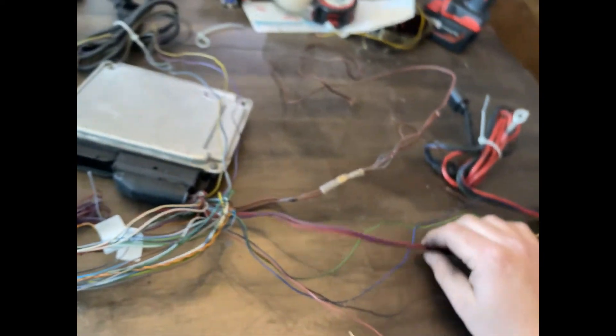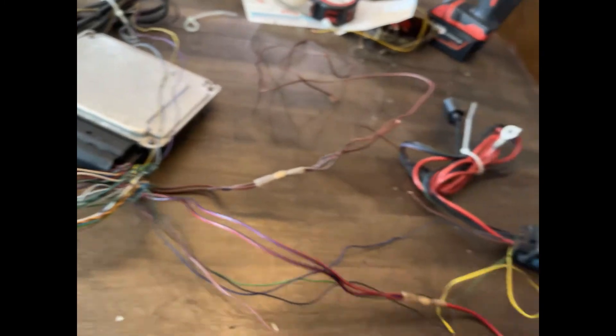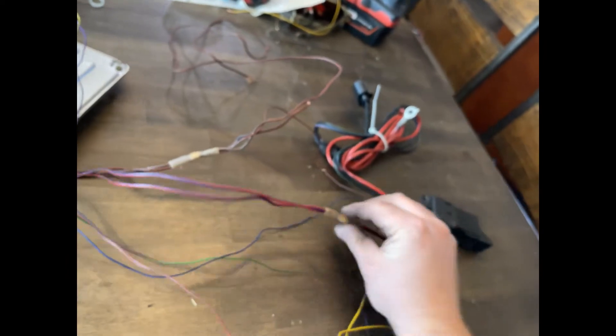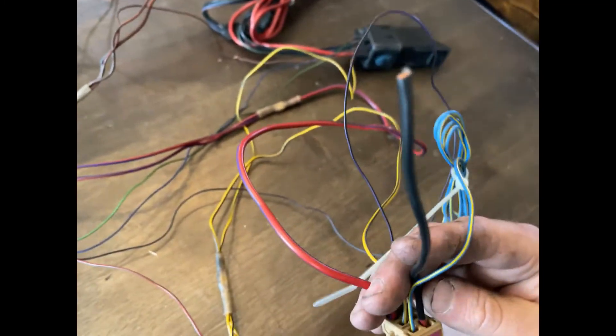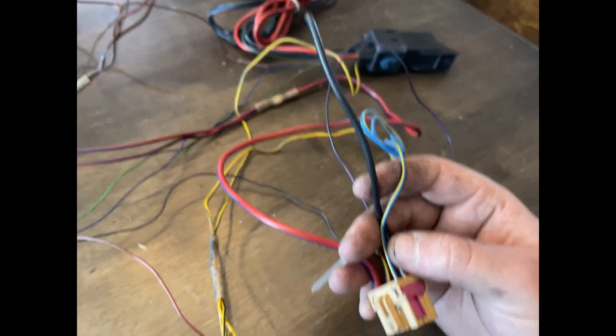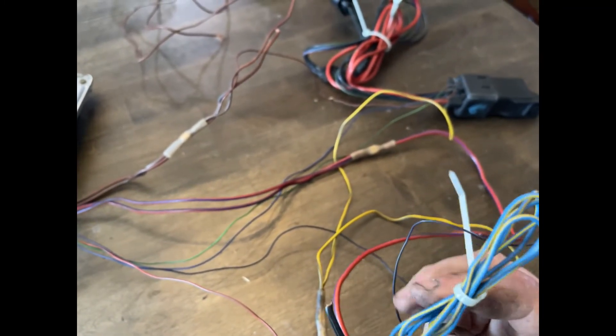This red and purple wire is 12-volt main power to the ECU, spliced external to the ECU and running directly into the brown connector, which gets 12-volt power on the other side. On the brown connector there's also a thin purple wire needing 12-volt power and a yellow-black wire, both spliced on that other side — you'll want to run fuses to those. There's also a red wire covered in black tape that leads to the automatic transmission, and a teal-yellow wire that's also disconnected.